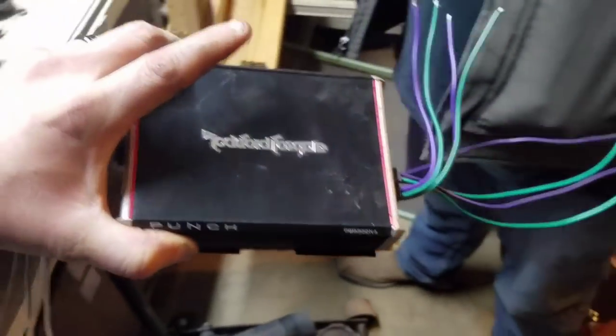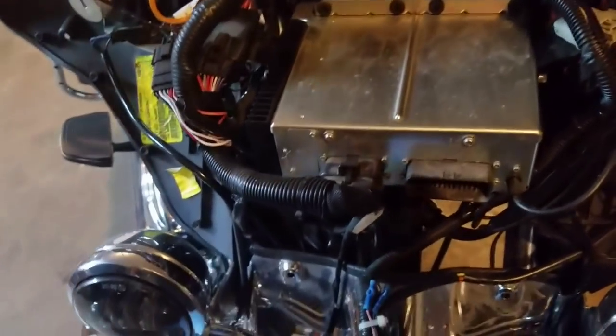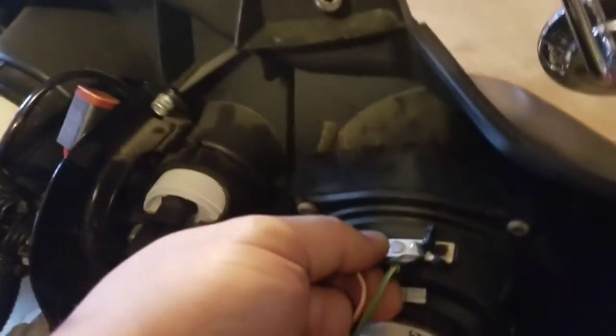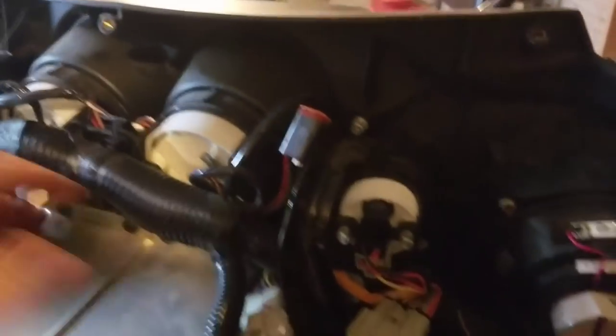Adam's gonna do the wiring part — he's my stereo guy. This might look difficult but it's actually fairly simple and direct. These are your speaker wires — you're just going to pull them off, that's all they do. Pull both these off. These come from the radio, so these are going to go to the input side of the radio and then the speakers are going to be the output — going in and then out.